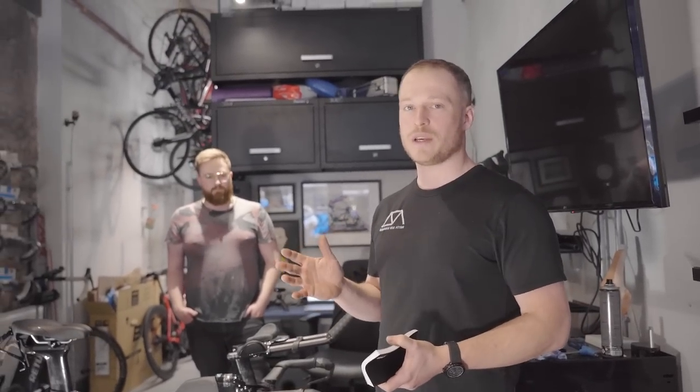I would say that if you have two soft tires, the biggest thing you're gonna do is have a pinch flat, or you'll slide out and crash, which is probably another big issue. Definitely, you can have this problem just if you're going too soft. If you're going too soft or too hard with the tire pressure, there's gonna be multiple problems. Obviously, too soft, you're gonna be wasting watts. You're gonna lose traction in the corners because the sidewall deforms. Or if you're going too hard, as soon as it rains, you probably will slide out. So you do have to be careful.